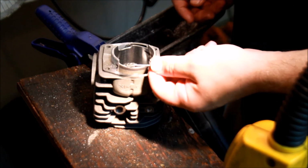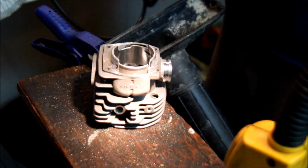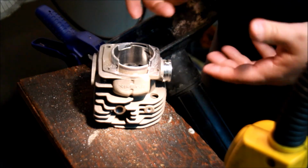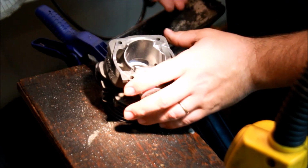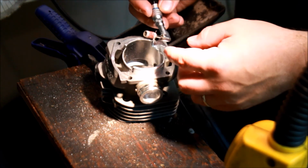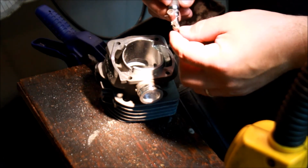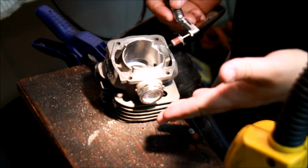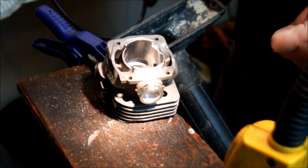I mean, I've gotten it to work. It isn't perfect. I wasn't perfectly able to shape everything in there, but the exits of the transfers do look pretty good. And that little sander on here definitely helps, but it's just a little too big. It won't quite fit in the transfers. It'll go on the outside and again shines that up real nice, so at least the exit of the transfer looks nice and is nice and even.